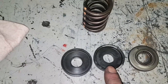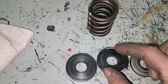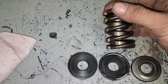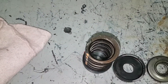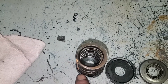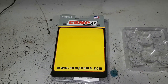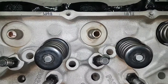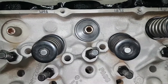This is a rotator eliminator that we ordered by accident and found it to have too small of an inside diameter — the inside of this cup was a little bit small. And this is the one we got from Comp that is the correct one. You'll see our valve springs — they're not a beehive style, they're a constant diameter spring — it doesn't quite sit in this cup perfectly, but as we get tension on it that spring is going to expand outwards and seat inside that cup. So these are the right ones. Just because we have the right parts doesn't mean we're done — we have a few more things to check and some things to correct before we go any further.